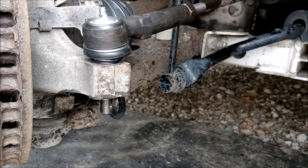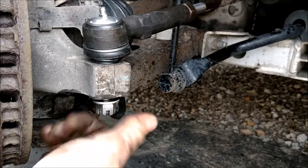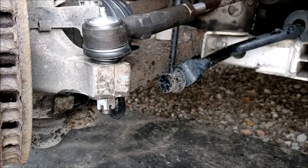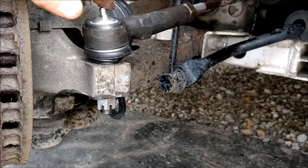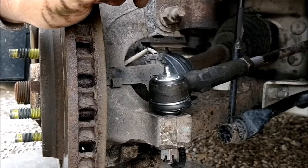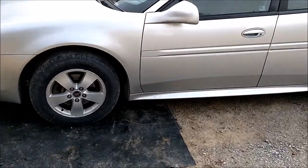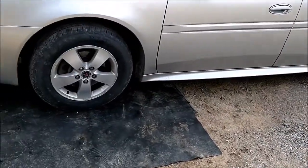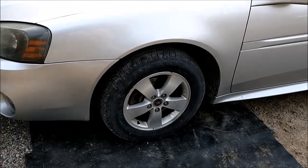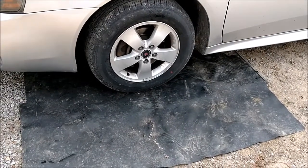It's in there. It came with a castle nut and a flat washer, just like the other side. Put that on there and we'll put our cotter key through that castle nut when we're done — that'll be it. Other than greasing this grease fitting, we'll tighten this up, put the cotter key in, and we'll be done. Hope y'all enjoyed the video — start to finish in less than 30 minutes, both sides. Parts were $50, so you've saved a couple hundred bucks at least. Thanks for watching, please like, comment, and subscribe.